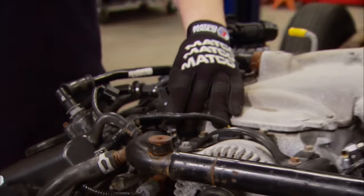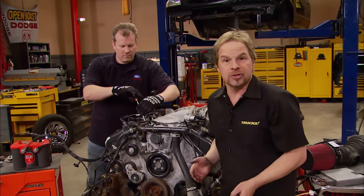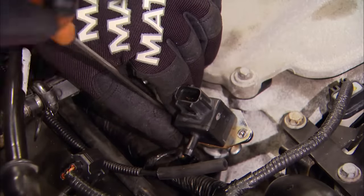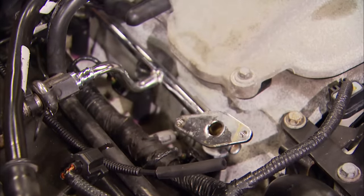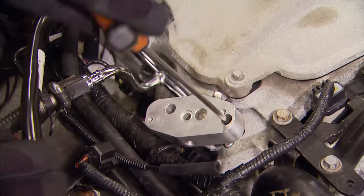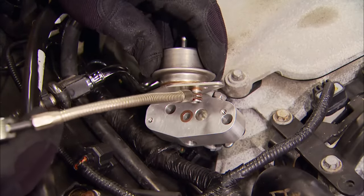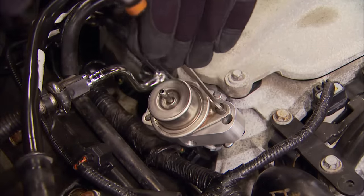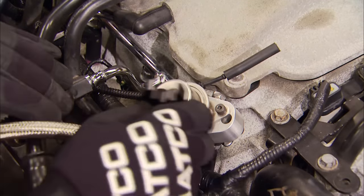Welcome back to Trucks, where we are moments away from firing off our 4.6 Mercury Marauder engine stuffed into our mini truck Project Rolling Thunder using Jeff Dunn's Dunrite performance harness system. But first we need to finish the conversion to a return style fuel system. We're going to remove the original fuel rail pressure sensor — this is the sensor that feeds information to the original Marauder PCM so it could determine proper voltage to the fuel pump for correct fuel rail pressure and injector pulse width. Our return line conversion starts with an adapter block; just make sure the O-rings are lubed before installing. The fuel outlet gets a new gasket and the fuel pressure regulator's O-rings also get lubed. To get the fuel back to the tank, we're using a dash-6 90-degree fitting sealed with Teflon tape.